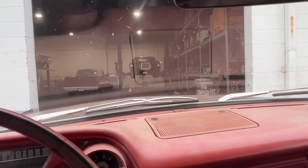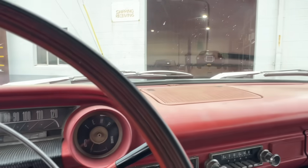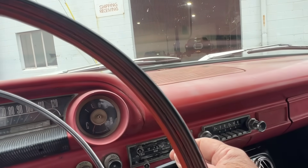I've been messing around with the exhaust system on this wagon. Thinking I'm going to be driving this thing for a while, it started making a really weird tinging, resonating sound. I remembered that the exhaust I threw on here came off a boosted car — off the Chevelle — and all the packing was blown out of it. It was literally just a beer can with some perforated metal in it, definitely not cool. So I swapped them out and put some turbo pipes on there yesterday and it doesn't resonate anymore — it sounds nice.